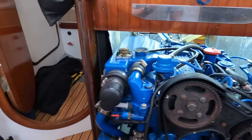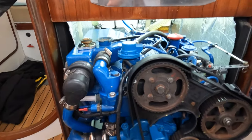Then I flushed the engine with water because I had to get the radiator flush acid out — I can't leave it in overnight because it's going to dissolve the engine and won't be good for it. So I got that out, and now I need to take the water pump off today, stick the hose pipe in there again for a proper good flush, and put the new water pump on. This is as good as we can get because we've run out of radiator flush stuff now. I'm kind of scared of flushing it too much with this acid stuff because this is an old engine block and there are probably some thin sections, especially around the head and the coolant tank — I really don't want to do more harm than good.